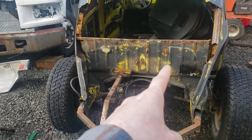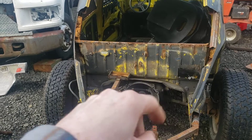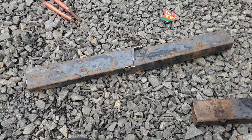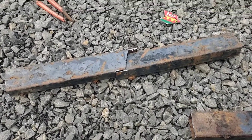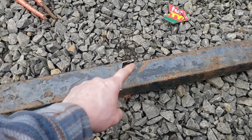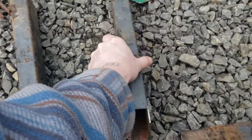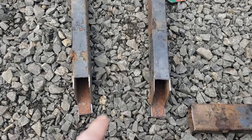I'm going to come out and around like that to give myself plenty of access around the engine and get rid of some of these little tabs that are in the way. I took this piece — I think it's like a two by three or one and a half by three, something like that — used my Sharpie and did kind of a Z-cut so it leaves me those tabs that I can drill through. These will be my initial uprights to start building my motor mount and jack shaft off of, so the next step is getting these drilled to size.